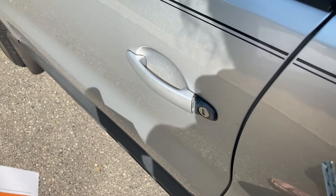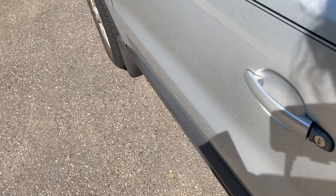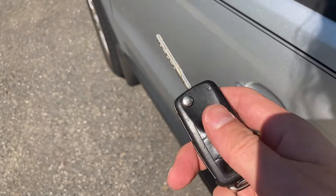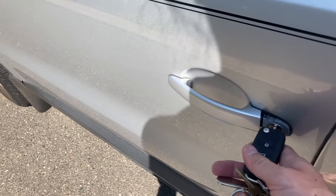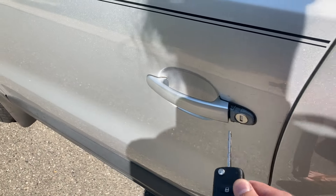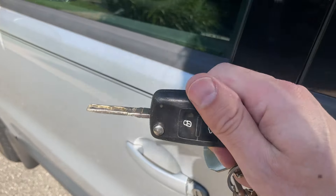See the link below in the description — I removed the cover in another video. This all has to be done quickly together. You take your key and let it pop out using the lock cylinder. Then within one minute of hitting the unlock button, you come over and turn the key left fully to unlock once. Afterwards, put that into the ignition to the on position without starting the car.